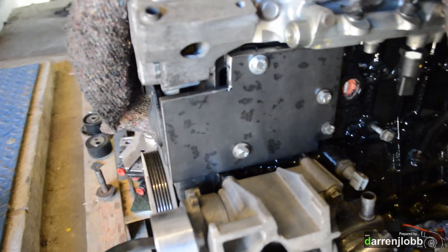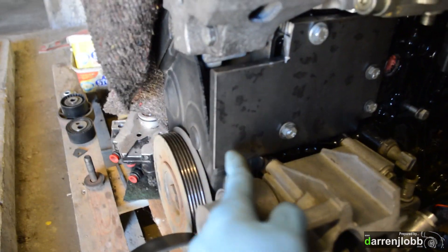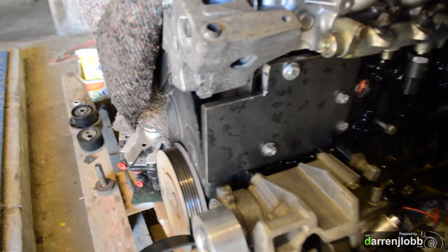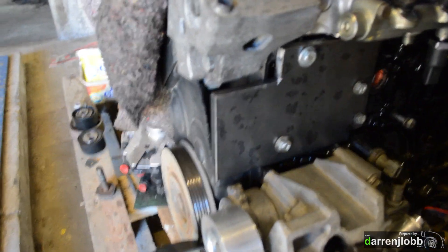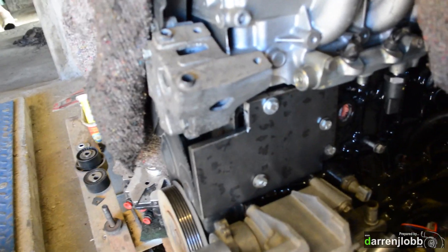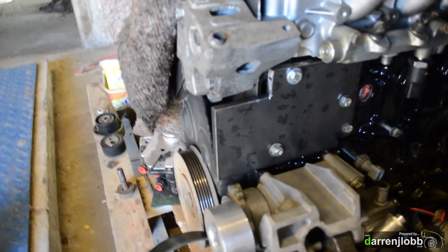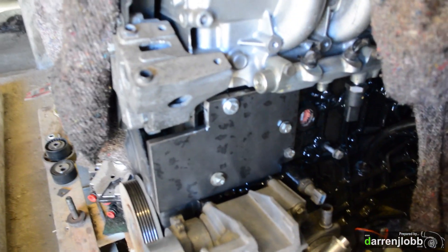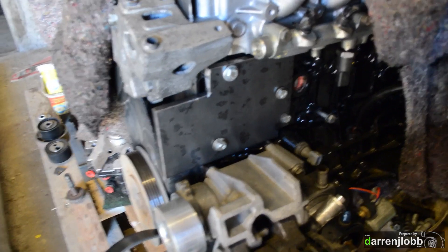Once that's bolted up it will sit something like that - so we've covered over the majority of this hole. I expect what I'll actually do here is I've got a little bit more to take off for belt clearance. What I'll probably do is take a bit off the end there and we'll have a piece of like 2mm plate welded in behind just to fill that gap, possibly even a bit up here if we want to be really thorough. Really it's just covering that gap - I'm not worried about dust and stuff, I'm just worried about having big holes where you can physically drop things in there. The amount of times you've been working on the top of the motor and you'll drop something and it'll disappear - if you've got that covered you haven't got a panic. It's just a complete pain because you've got to take off the crank pulley and belt covers just to retrieve an M8 nut or something dropped in the belt covers. Sometimes you'll drop it and lose it and you've got to strip it anyway just to be 100% sure it hasn't gone down there.